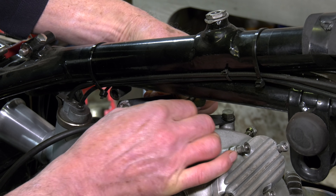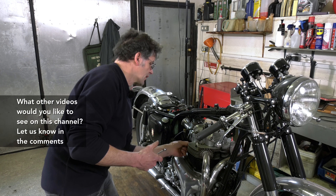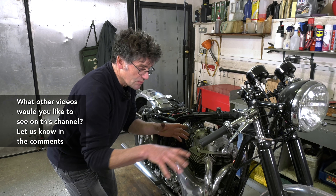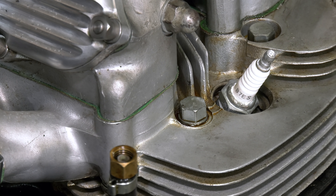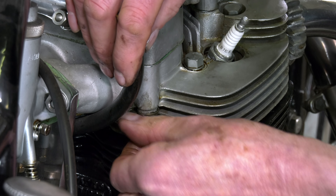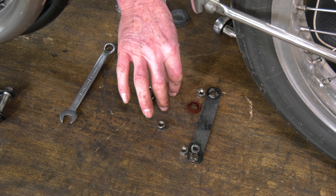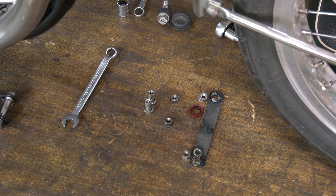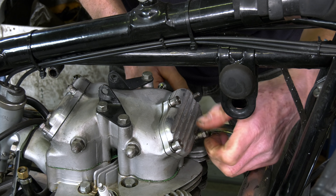That actually is a replacement Indian tank — they're good quality, not all rusted out like the old ones. What you find sometimes with rocker boxes, getting hot and cool again repeatedly, you'll find that the gaskets are all slacking off a little bit. And if you use silicone, that's when they start to move. These bolts on the back here have slackened off quite a lot, and you can see there's quite a lot of oil around. I tend to always put things back in formation to where I've taken them apart — lay things out on the bench, or pre-assemble things once it's taken apart.